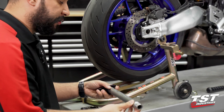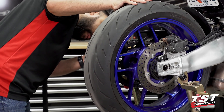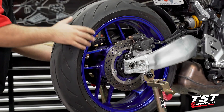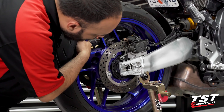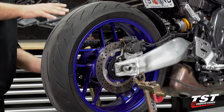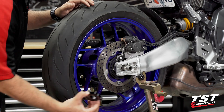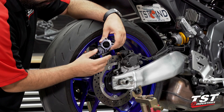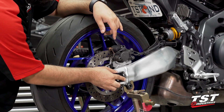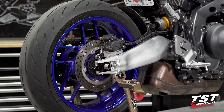Now that we know that's good to go, we can reinsert the axle rod into the rear wheel and the swing arm. Make sure your holes are aligned, and wiggle it around ever so gently to ensure everything is seated properly on all faces. Now the axle is sitting completely flush in the recess on the Womitech axle block protector. For the opposite side, you'll notice one side has two punch-outs and the other side has four smaller ones — have the side with the two punch-outs facing flush against the inner portion of the swing arm. Wiggle the tire around to confirm it's good to go, and that piece is now locked in.